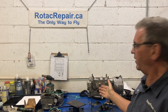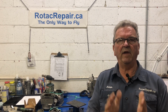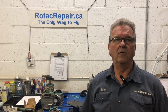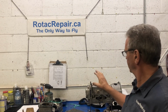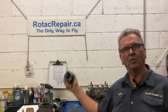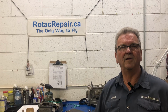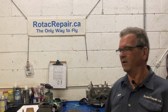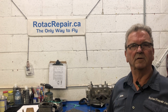And of course, we have the crankcase, as you just saw, the mating surface is ruined from cleaning with some kind of power tool. Who knows what they used on it, but it was cleaned improperly and it damaged the surface. We need a crankcase. We need a crankshaft. We need pistons. We need to bore the cylinders. In reality, it's just more economical to buy a new short block, because with the exception of the cylinder head, this is just all junk.